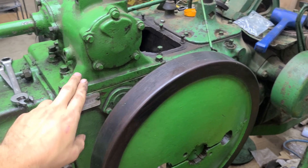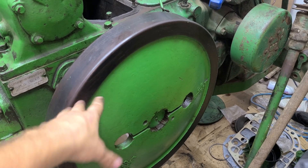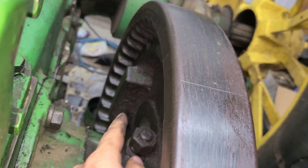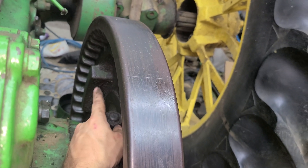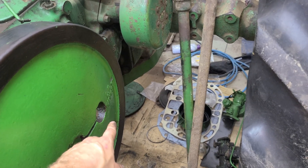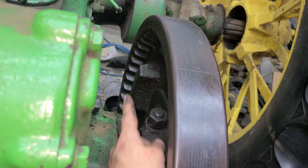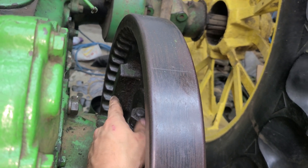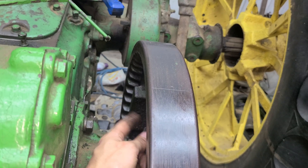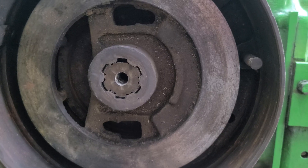At this point you have your crankshaft timed to the camshaft and your flywheel set and positioned correctly. This is important because the flywheel is not perfectly symmetrical — there is weight on the back side, which is a very important factor. Even if a flywheel doesn't have the impulse marking, that weight goes exactly at three o'clock. This is critical for balance, and any balance issue could stem from the weight being off on the flywheel or the clutch driver.